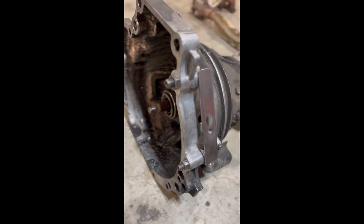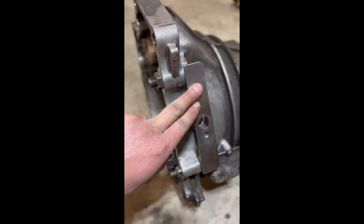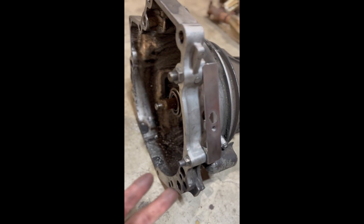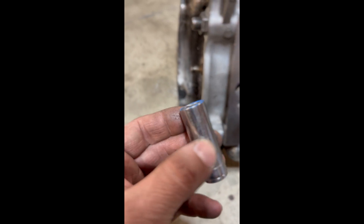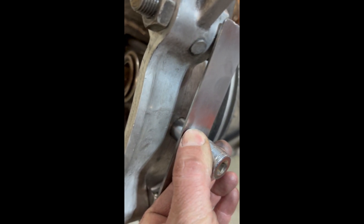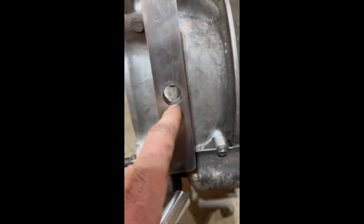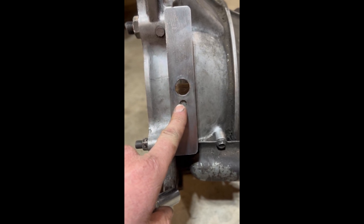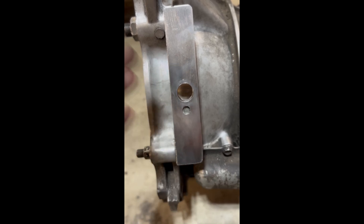Moving on to the crank angle sensor bracket. I have tried to make this as simple as I could for you guys buying this kit. All you have to do is simply mount your bracket to the transmission, preferably outside of the vehicle, and not attached to the engine unless you want aluminum flakes all over your clutch and flywheel. You take a little bit of paint with a paint pen and put it on the end of a half-inch quarter-drive socket. You place it through the hole with wet paint on it, marking a nice mark for where to make a hole for your sensor. And you start out with a small bit.